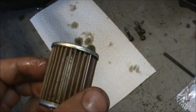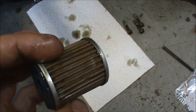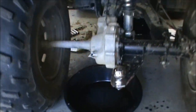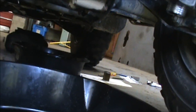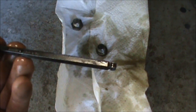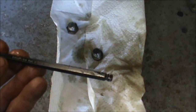Put that o-ring in, new oil filter, get that all back together. This filter has got a little bit of crud here and there, which could be a lot worse, so I'm happy with that - at least it's not all gunked up. The oil didn't really look too dirty but I'd rather be safe than sorry since I don't know a whole lot about this thing yet.